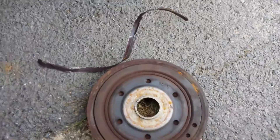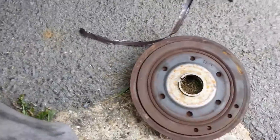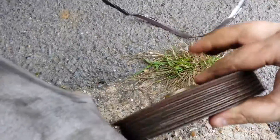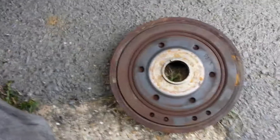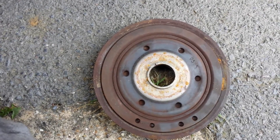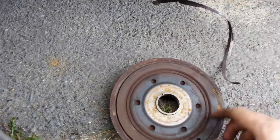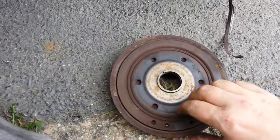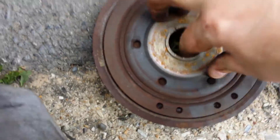Hello everyone. This is a different video to all my others, but back in the old realms of the Peugeot. This is a bottom crank pulley. If you think of this being the engine side, what will happen is you'll sometimes start hearing a clicking noise, not too dissimilar to tappets that needed adjusting on engines of days gone by. There's a spring and rubber components inside — Peugeot's attempt at reducing vibration — and there's now a definite flex to it that I can feel, so it's ruined.